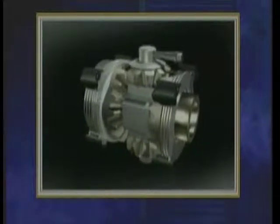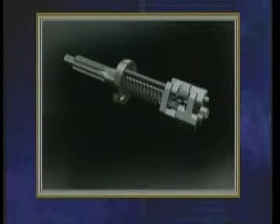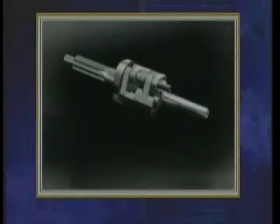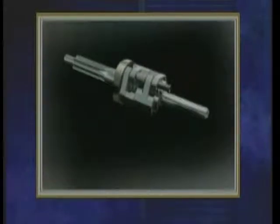The device that initially activates the cam plate is the engagement mechanism. It is connected to the cam plate by a small shaft, which attaches to the mechanism through cone clutches at each plate. The mechanism rotates when the torque between the shaft and the mechanism is greater than the cone clutch torque.